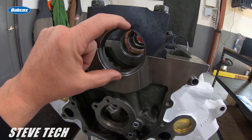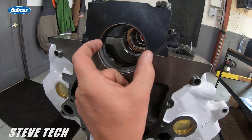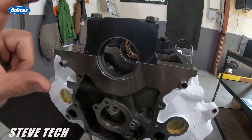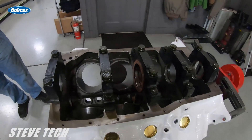As the crankshaft tries to get pushed out of the bottom of the block — since it's upside down here and the cap is trying to push away — this dimension actually gets tight. So it is naturally big, machined into the bearing. They are actually oval. This would be your tightest spot when not running, but as it runs and sees more power it grows this way, which makes the other direction shrink. It's like taking a piece of tubing and crushing it — it gets wider at one end and narrower at the other.